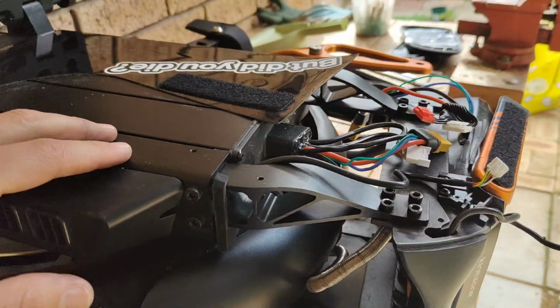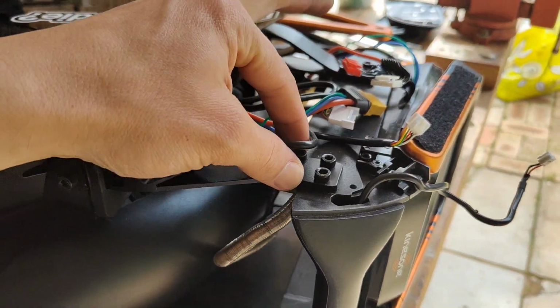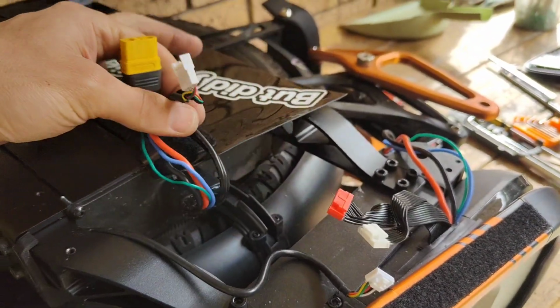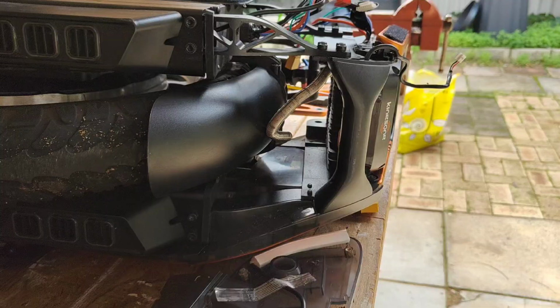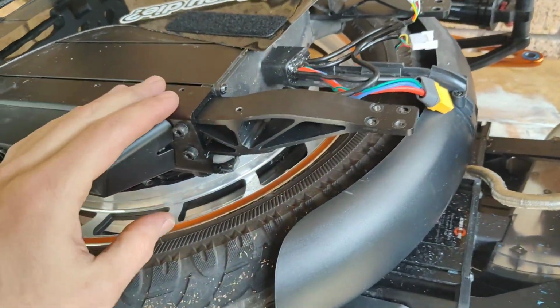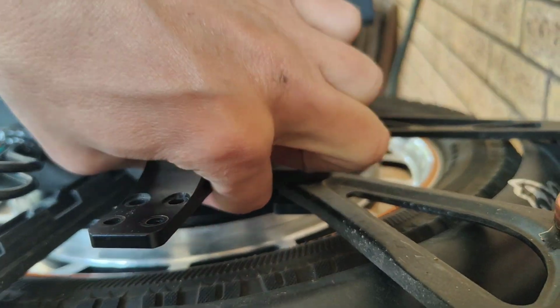You've got that body off, you can see the frame design. The top housing has one bracket here, one bracket here. If you take them off and you disconnect the motor and the lights, you should be able to slide the whole battery off on both sides. The top 8 bolts removed. Does slide down, but you are then handicapped by the rubber gasket on the front and on the rear.